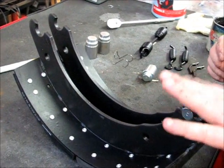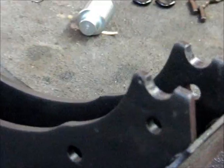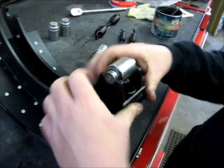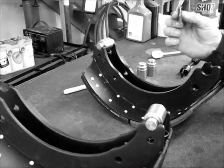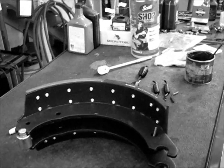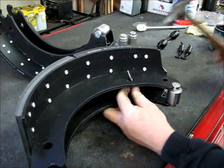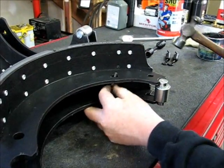Some people say they'll do it, but just a little bit more love on the brakes. Wire them up, put them in, lock them down — it's that simple. The only other thing we have to do is put our spring hold-downs on. They're pretty easy. Get yourself a nice little hammer, and watch your finger. Lock them in, hit them with a hammer, and they're locked in.